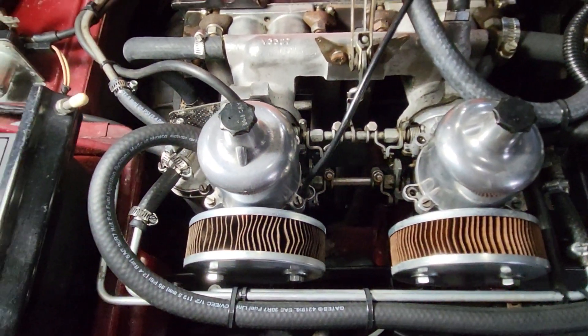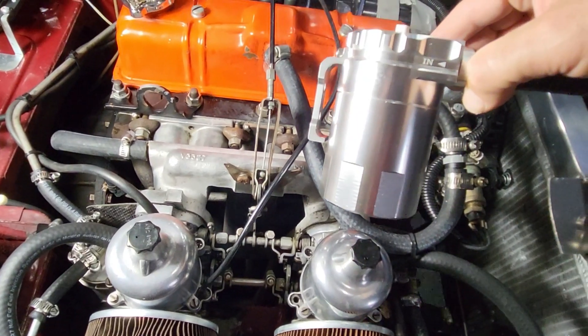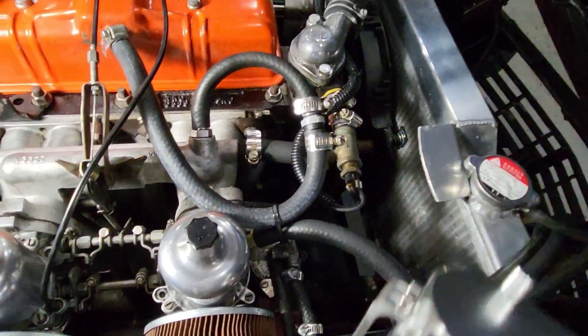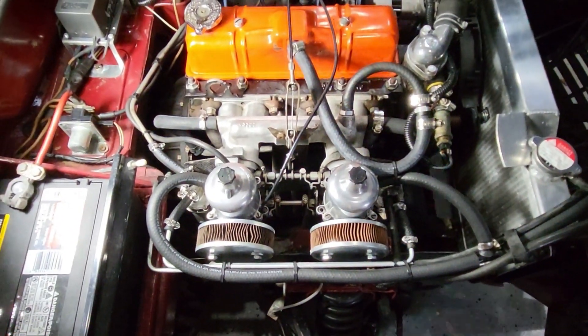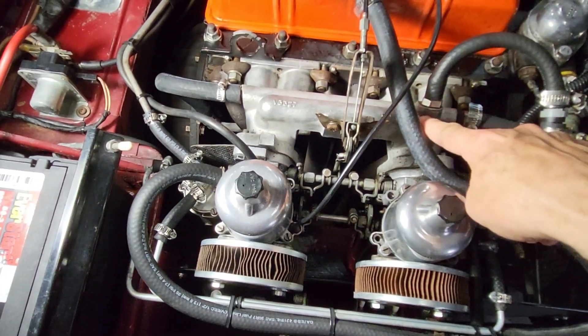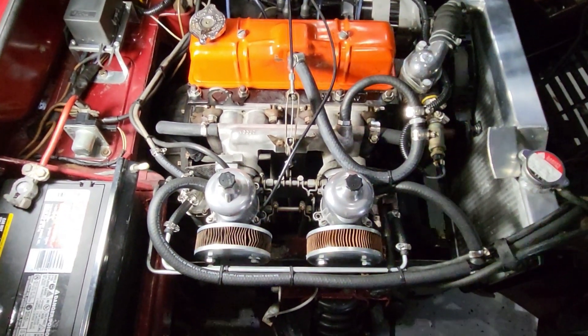That was also what I did on my first solution. What was my first solution? I didn't use a PCV valve. What I ended up doing was putting a scavenger tank in up front on the baffle — you can see where the screws are still in place and I'll take those out. What I forgot to recognize was that I needed a PCV valve. I probably would have kept that tank if I had more room in the engine compartment, but I really didn't like the way the lines looked. Without a PCV valve, I had 15 inches of mercury directly to the manifold, and that caused a real lean condition and a lot of backfire. Not good.